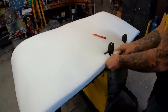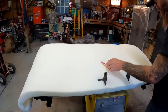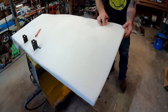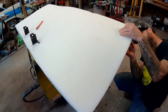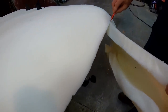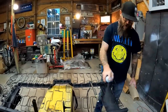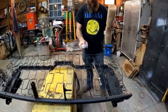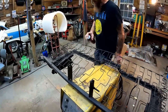I think we're positioned pretty well. We'll take the same marker and come around and mark all the way around this thing and trim off. I've got it lined up pretty good with the edge, but you have to trim off the corners for sure. Got my foam kind of roughed in — it's not trimmed perfectly yet but the length is straightened out. I'm going to run a little bit of glue and put my burlap on. I think this is going to help with the springs — keep them from eating into my foam.